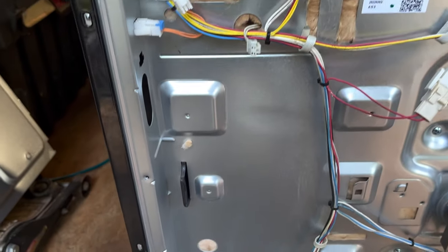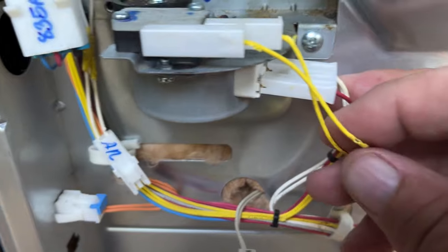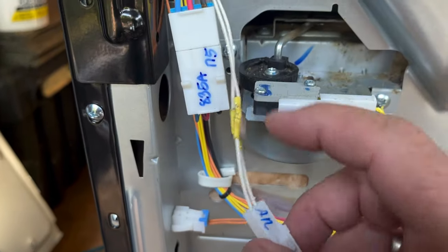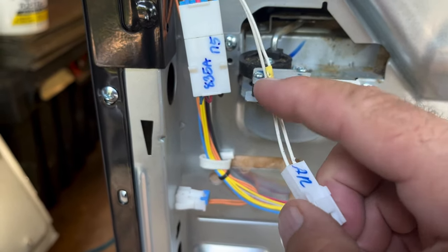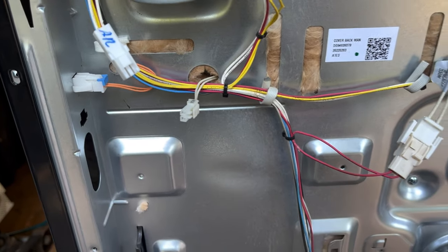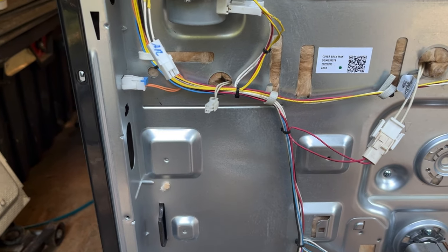When I did remove the rear panel, what I found was a little bit of mice droppings, and many of the wires were chewed — including the wire for the probe, which was chewed right through. So I reconnected that, soldered those wires together, put some heat shrink on it, connected it up, went around front, and she fired right up with no C20 error code. That confirms that the C20 is the probe code.